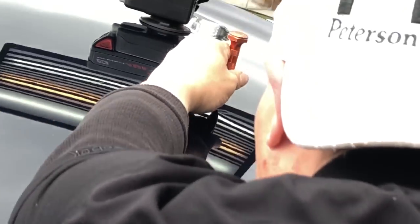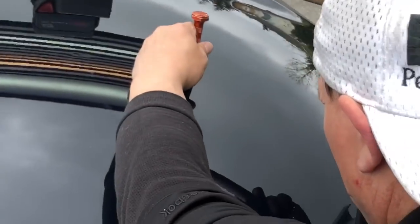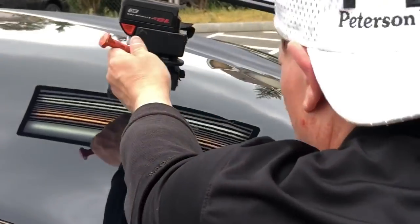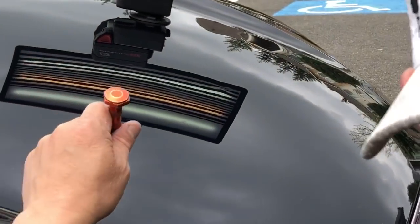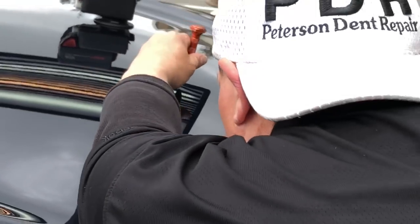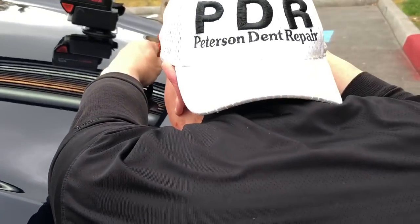just your normal aluminum. It's got the aluminum tendencies, and what that means to a dent guy is not a lot of give. It stays where you put it, it doesn't bounce back like steel does. It's got a little bit of different personality. Metal has kind of a personality when you move it.